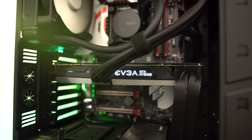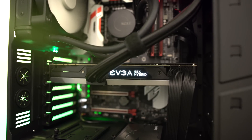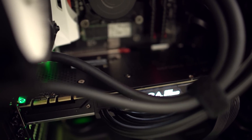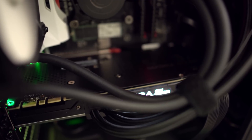In the past, a lot of the systems that we built required a total custom liquid cooling system for the entire system — it was a lot of work. This time we decided to go with all AIO stuff so that everything's all-in-one, which makes it much simpler. So for the video card, we used one by EVGA. It's a complete hybrid card — this is their 980 Ti series, and it comes with its own liquid cooler right out of the box, geared for people doing overclocking. The major feature of the hybrid card is that it features not only liquid cooling but also a fan on board as well, so no matter what's going on your card's going to get cooled properly.